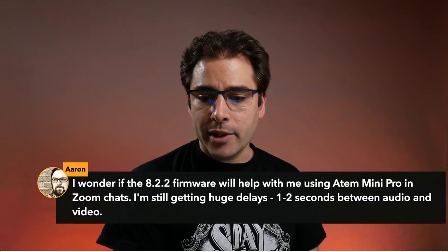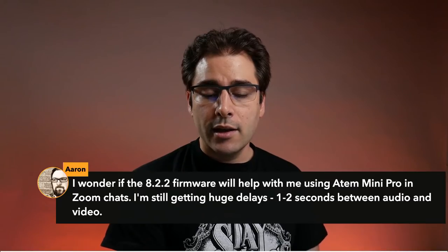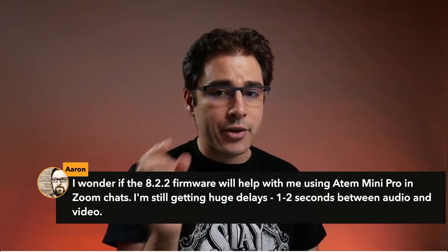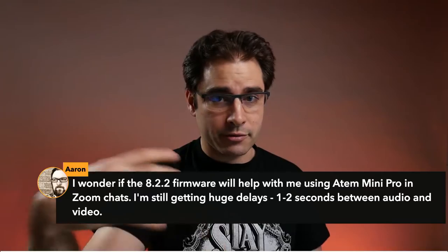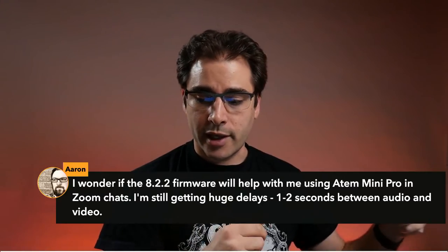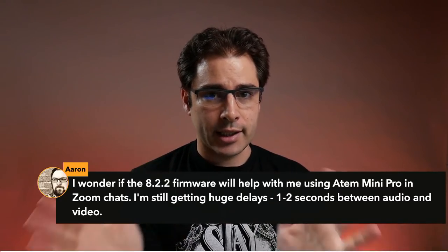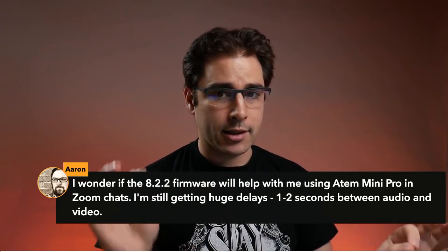Aaron says, I wonder if the firmware update will help me with using ATEM Mini Pro in Zoom. I'm still getting huge delays, 1 to 2 seconds. This is something I've been seeing happen a lot with some people. If your audio and video are in sync in the ATEM Mini, which you can verify by plugging in an HDMI monitor and listening with headphones or some other way of checking what's going on in the ATEM Mini itself, and then in your computer you're getting out of sync or delays, the problem is the link between the ATEM Mini and the computer.